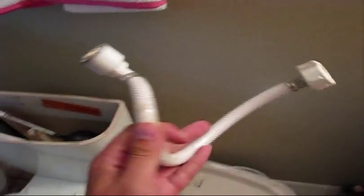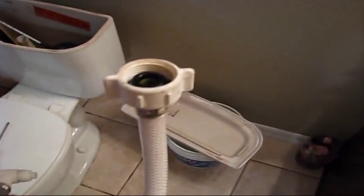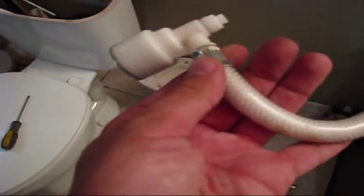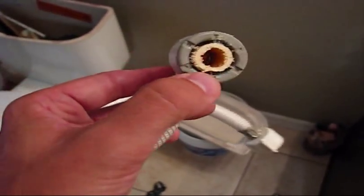There is still a ring there. This is how the old one looks — as you can see, it's crimped for sure. Because we need to replace this hose which goes from the reservoir to the valve, we had to cut the whole valve together with a piece of the hose. Before we install the new one, we need to remove this ring. There is also a metal clip located right there. We will use pliers to cut it and then remove this ring.